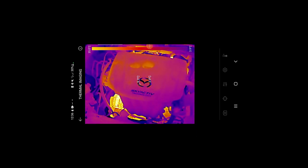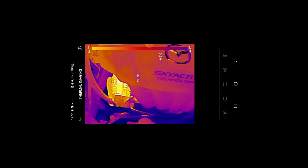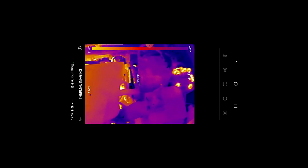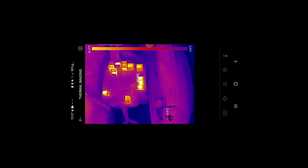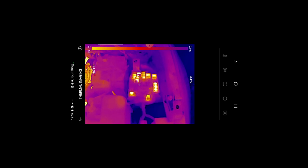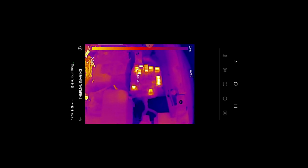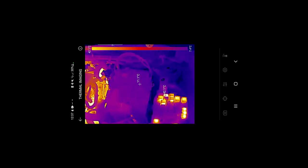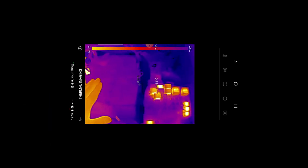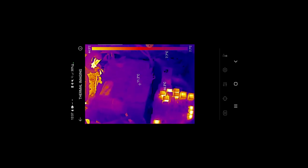I've lifted the engine bonnet with the engine running. Things look as though they're glowing molten hot but they're not — the alternator temperature is around 30 degrees with the engine cover on. I've taken the fuse box lid off and you can see all the relays showing heat signatures. Anyone in the automotive world will know a thermal imaging camera is a good tool for checking parasitic drains — to see if any relays or fuses are active. You can also check for resistance in battery terminals, since bad connections cause heat. Touching the battery terminal leaves a small heat signature from my hand, but luckily there are no problems with this car.